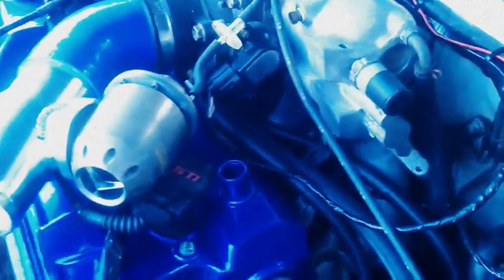But yeah, everything is sealed up. The cooling system is sealed up. I had to take off that fan on that side. If it starts running hot, then I'm going to have to figure out something else, maybe get a flatter fan, but it bumps my turbo piping whenever I have it bolted in, which is a little bit of a pain. But yeah, the cooling system is sealed up. The air intake system is sealed up on the manifold side. I still have to finish up the piping over here, get some more couplers and pipes, unless I can find somebody that can weld aluminum. I stopped buying couplers and piping stuff because I actually want somebody to weld it up. I don't want to have to worry about air leaks and all that stuff.